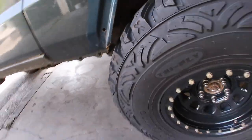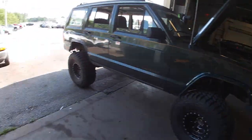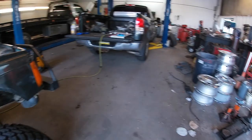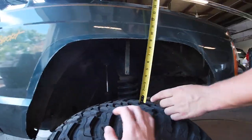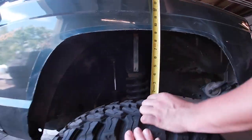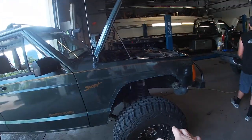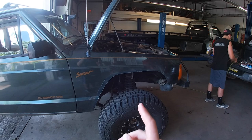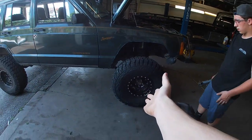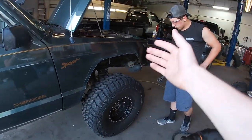Just got a little bit left to do on the fender, and just like that both front fenders are done. Before it was seven and three quarters inches, now it's at nine and a quarter - we freed up almost two inches of space. That means more room for flex, and there's definitely room for 35s and to take it off-road without worrying too much about ruining the tires on the fenders.